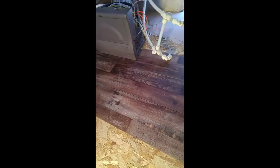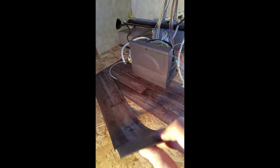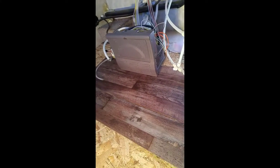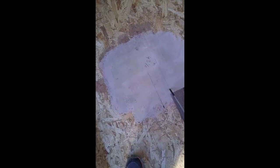They are 7 by 32 inch floor planks and the edges are beveled inward so that they line up easier. It's a vinyl glue-on — I got the glue. What I did was I marked the center of the trailer line, which is here, and then I went three inches over so I could start with a full plank. I snapped the chalk line all the way up, and they're just laid down to get a look at them.